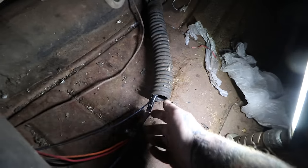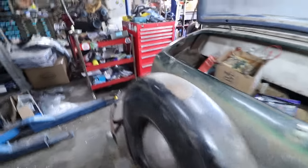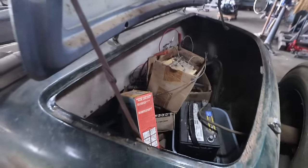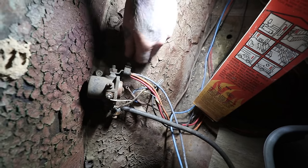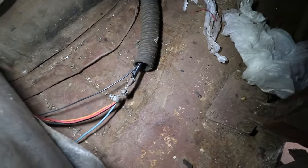Basically that battery cable then goes to a clamp here with three or four smaller wires which run all the way into the trunk. I was trying to figure out where the heavy battery cable went for the 12-volt battery in the trunk. Those thin wires go to this clamp, to the solenoid. So he was basically bunching a bunch of wires together, which was supposed to equal the same gauge thickness, I guess, in theory, as the battery cable, and he didn't have a long enough heavy cable. So all of that's definitely the stuff we want to delete and try to do a little better, even though it obviously did work at some point.